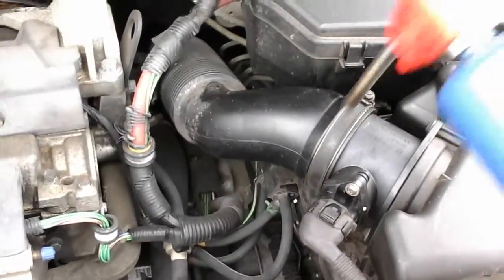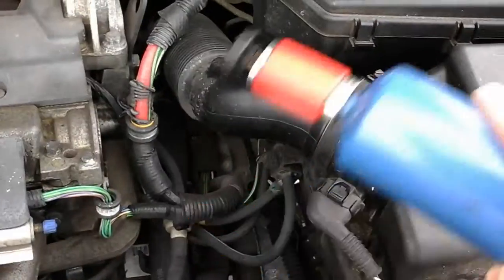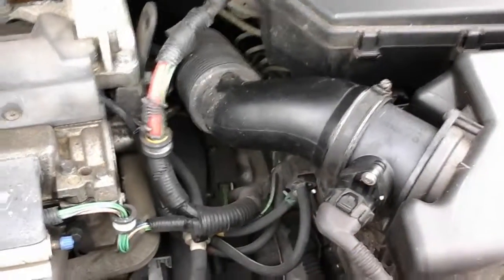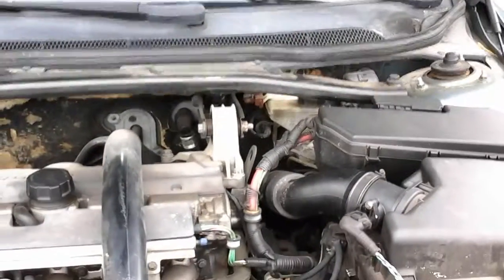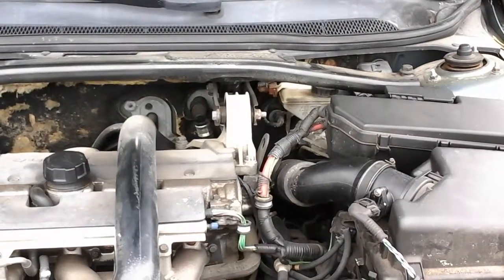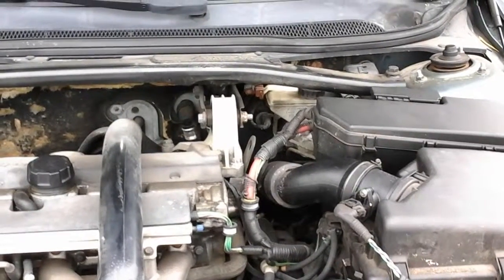You know, don't melt anything — we're just talking about warming it up maybe 30 degrees all the way around. It'll pop right off, then pop the new one on and you're set to go. Just a few seconds. A tip that might help you stop pulling your hair out dealing with these plastic intake hoses on European cars.